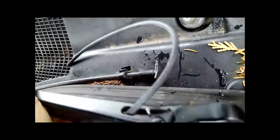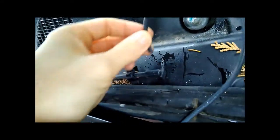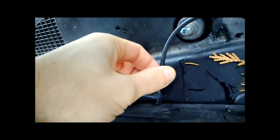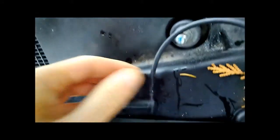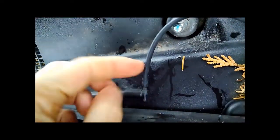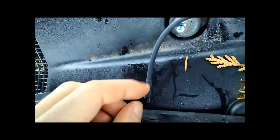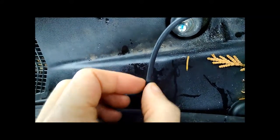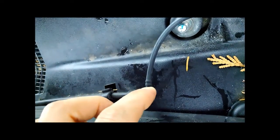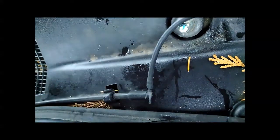Here's the new wiper arm. As you might guess, reconnect the hose piece first, and then we can deal with the spline. There is a nipple on this piece, so you have to get the hose over that nub by exerting some force to physically push the rubber over it. Otherwise, it'll pop off when you pressurize the line and it'll leak. Make sure you put enough force that the rubber is completely over that nipple — then it's nice and secure.